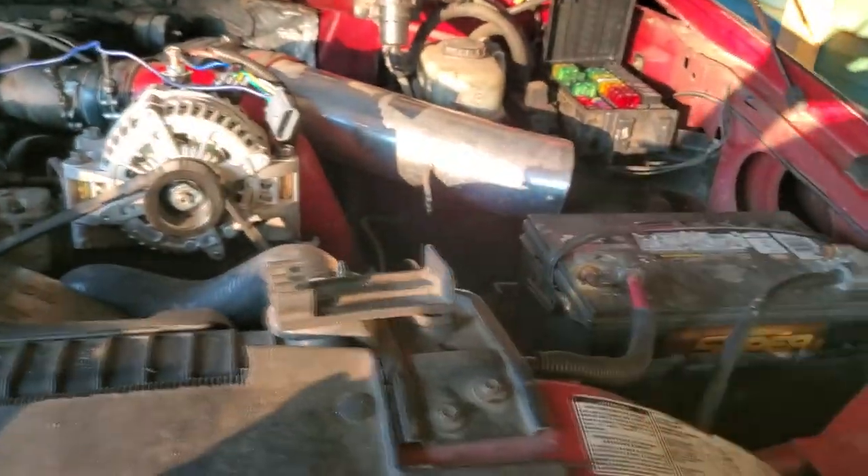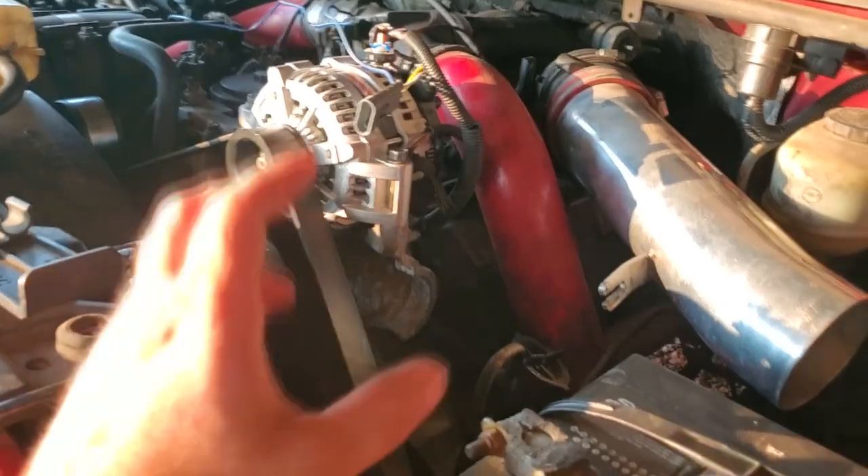We can walk over here. I've been doing a little mock-up work on the truck. I'm hoping to start this by the end of this week, hopefully next week for sure. We've mocked up — this is one of the Mechmans, and this is the other Mechman right here. Both of these will be going one here, one here. We're going to do some custom bracketry. Once I get the steel to cut those out, I'll show you more of how I'm going to do this. If you've got a 7.3 Power Stroke and you're looking to do a dual alt, this could be something I could either give you the plans for or build it for you. The only bracketry they make for that truck is the ambulance style, and you can't buy those parts anymore — nobody has them in stock. If you can find them on an old ambulance, that'd be the only way to do it.